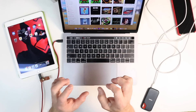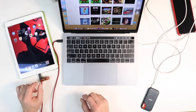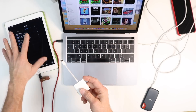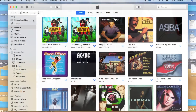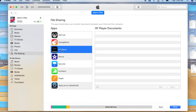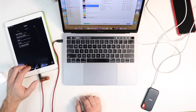To get high-res music to play back through the micro USB on the front using the Sabre DAC, the most popular method is using an iPad running the Onkyo app. You'll need the Apple Camera Connection Kit, which gives you a Lightning connector on one end and USB out. You can't just go directly from the Lightning connector into the unit. Once you've bought the app and put it on your iPad, plug it in and at the top of the screen select Music, then the iPad icon, then come down to File Sharing and select the Onkyo app from the side panel. It will sync over and on the right is all the music you've downloaded to the device.